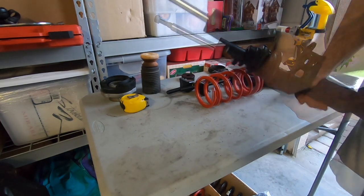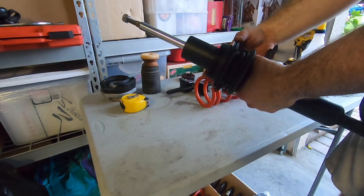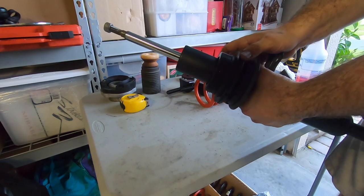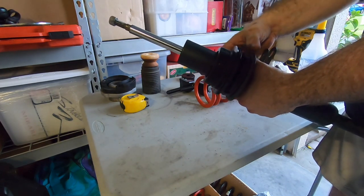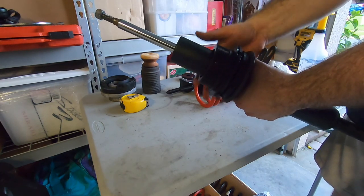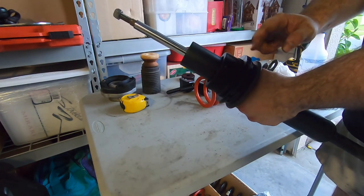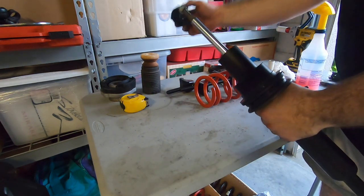In the back there's a bottom ring and a top ring. The bottom ring I'm going all the way down because I'm starting with these all the way down and will adjust from there. The top ring is the lock — once you use the adjusting ring to set the height, the second one locks it in place. What's awesome is that where this is placed in the car, to adjust it all you have to do is take the wheel off and you can get right to it. A wrench comes with it to adjust — very user friendly.